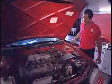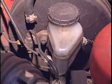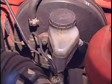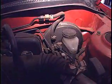These all look good. We checked the other major components of the brake system, which brings us back to the master cylinder. You want to make sure there's no external leaks around the base of the master cylinder or the reservoir. This looks fine, and we're assuming that there's an internal leak.